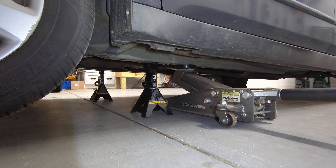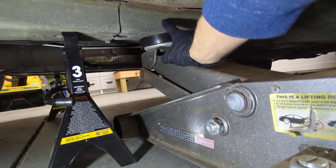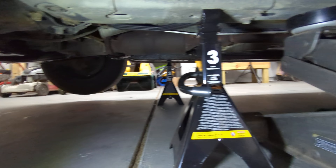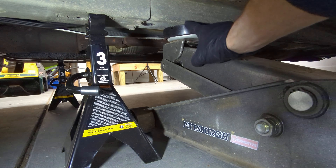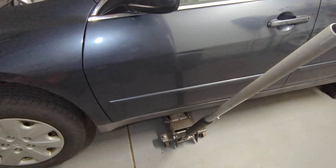I'm going to go ahead and turn it off and pop the hood — down here by the gas pedal and the brake pedal, just pull that. Go ahead and take the oil fill cap off so that when we drain the oil it'll drain better.